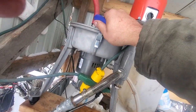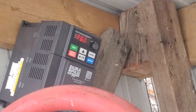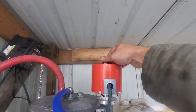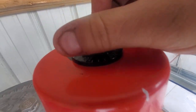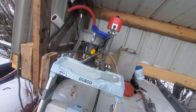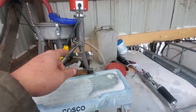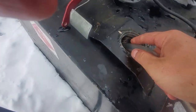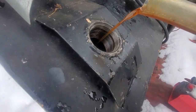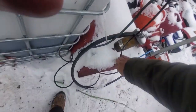A centrifuge is a lot more money — do some research. In the US it would probably be $2,500 or more if you get the heater. This is a 6,000-RPM unit running a 240 motor, and you need that converter box. I've got this one turned all the way up — it's actually too cold to run it right now. You can hear the click — see about what our temperature is being kept at, I'm guessing 150 or so. I've got it coming out of the overflow quite a bit, so this is probably too fast. I'm going to unplug my heating element to slow that flow down.